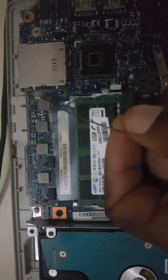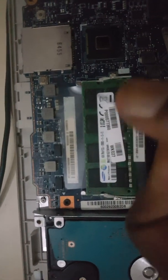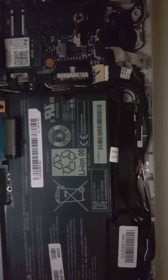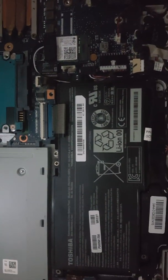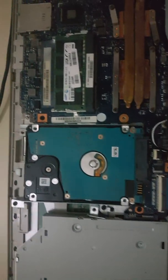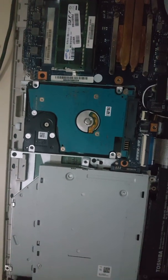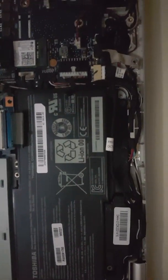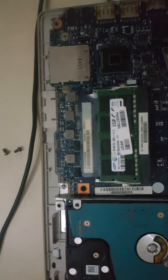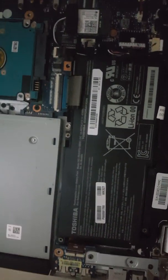So I decided to hit this second button as well. I hit this one a couple of times and then hit the other one a couple of times. I pulled out the battery and held the power button for one minute — at this point I was so frustrated I wasn't in a hurry anymore. Then I plugged in the power cable and it worked. I plugged the battery back in and tried to power it on again, but it wouldn't come on, so I came back and did the reset again, plugged in the power cable, and boom — it came on.